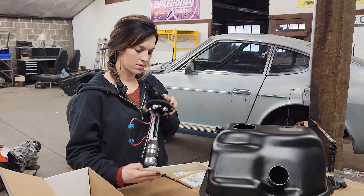So we got this all torqued down. We did a star pattern and those are all to around 60 inch pounds. You can see that gasket gets squished down quite a bit. Looks awesome. So then we'll figure out where we want these — do some test fitting under the car. We might put a little padding on top to protect the wires and stuff. So that'll wrap up this video. We are super excited to try this Holley pump. This whole unit is just really nice. We'll start on some plumbing and running some fuel lines, and we'll have a follow-up video of when this is working. Thanks for watching.